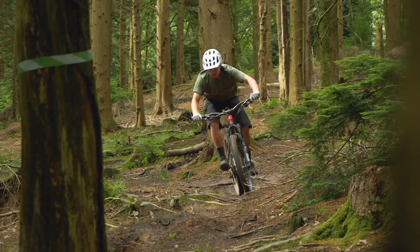A very stiff wheel on the front can sometimes be fatiguing on your hands. Some newer wheels, like certain Zipp models, are made without a box section, making them very vertically compliant — which would work well on the front. The elephant in the room with carbon on the rear is that carbon can break under high impacts, especially with more weight on the rear wheel. There are so many variables — riding style, location — so it's hard to give a definitive answer, but carbon will likely give a bigger performance gain on the rear.